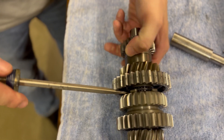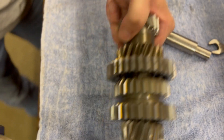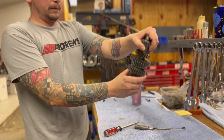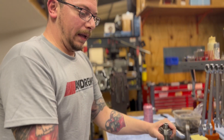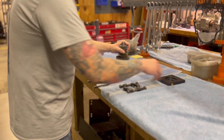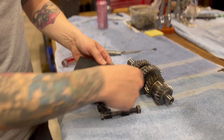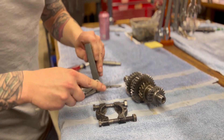Press the snap ring down towards the 3c gear, which is your slider gear. You gain some access here — now any bearing splitter would work, but we do have our own Baker countershaft tool and it fits nice into that groove underneath your gear. Take a half-inch wrench.